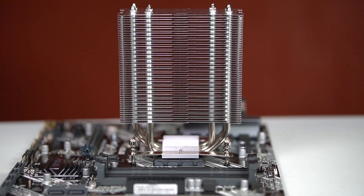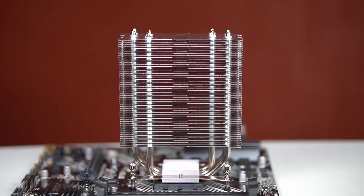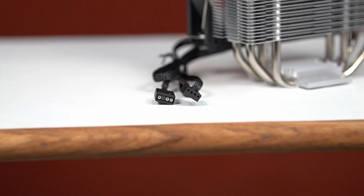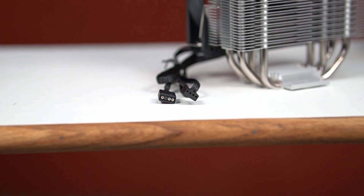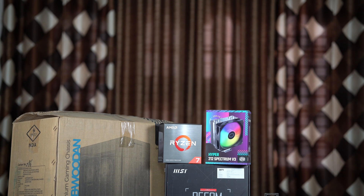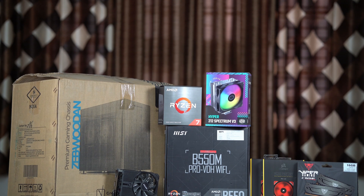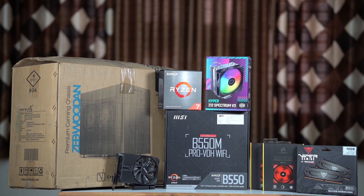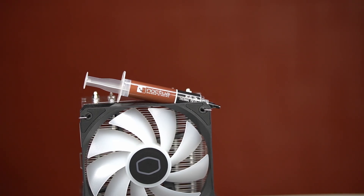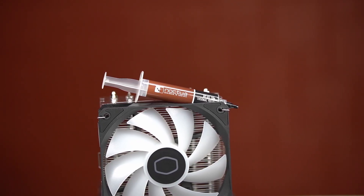The last thing I really liked about this cooler is how easy it was to mount to any CPU. If you are not sure whether this cooler is right for you, I suggest you get an idea about your CPU's power draw under full load. If your CPU consumes less than 100W under full load, this cooler will be sufficient to keep your CPU temperatures under 75°C in the worst case. But this is just a rough idea — CPU temperatures depend on ambient room temperature, the use of good quality thermal paste, airflow inside your case, and some other factors too.